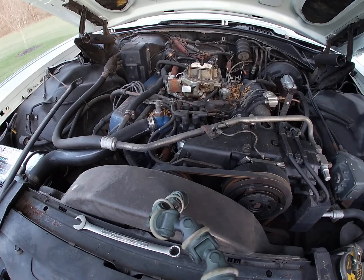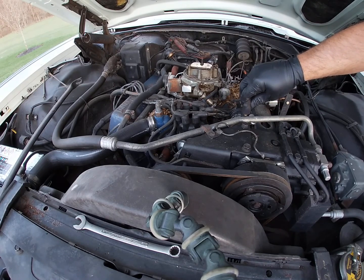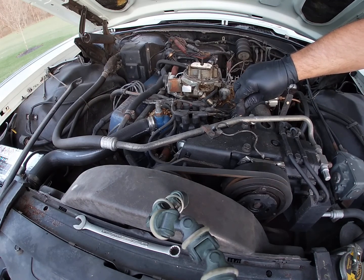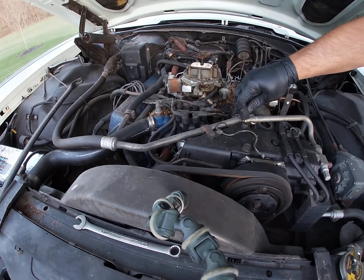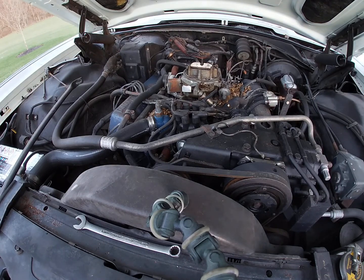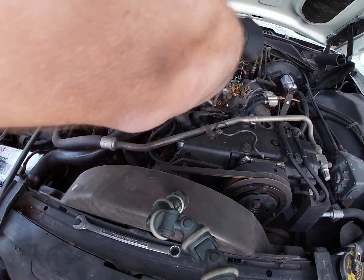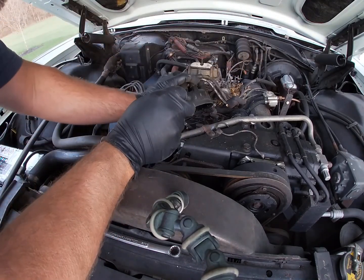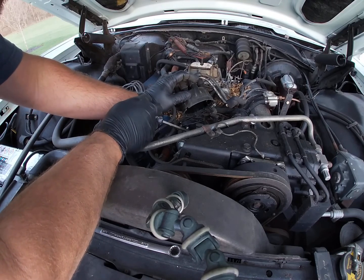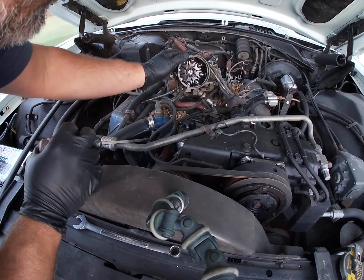All right, get in there. Turn it over. Rolling. All right, we got a coil from one of our parts cars here. Thanks for taking parts from a parts car to put it on another parts car to start it. Go ahead, Blake. We're not getting spark. Let me make sure this distributor's points are still working here. Good points. Spark at the points here.